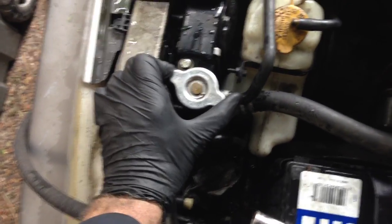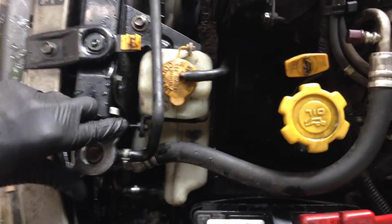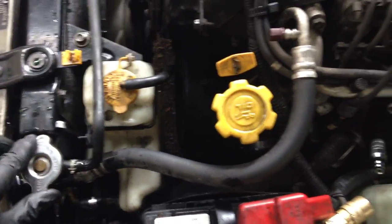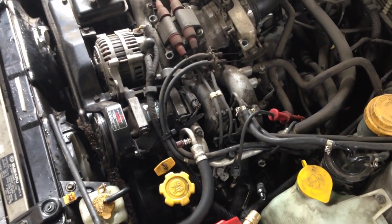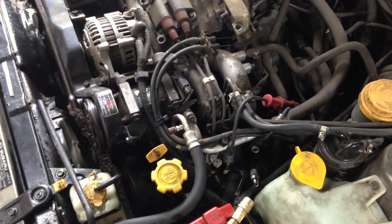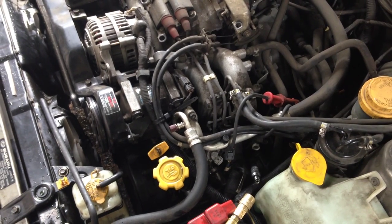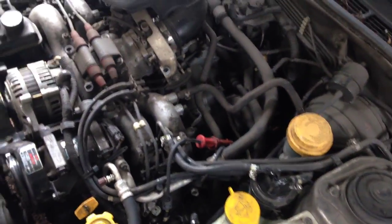There is pressure on this — I just released the cap and it all spat out. And that was basically how I completely ruled out a bad head gasket on the portion in between the cylinder and the cooling jacket. I'll go ahead and put the video recorder down and let you observe what I have going on here.